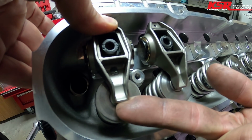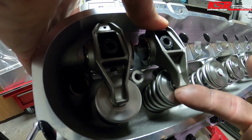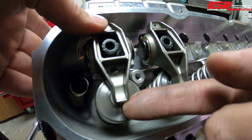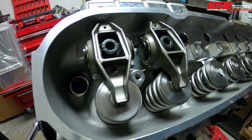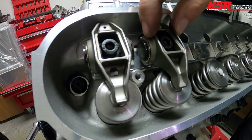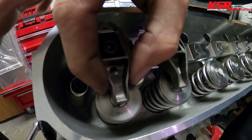So that's the hydraulic part that's normally taken up by oil pressure and the design of the lifter. Somewhere between there and just a slight amount of preload is what we're after. Now I'll double check with Texas Speed on my part number that I think I saw on the lifters, and then we'll get the correct amount of preload.